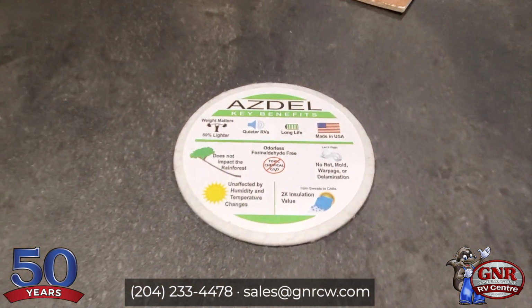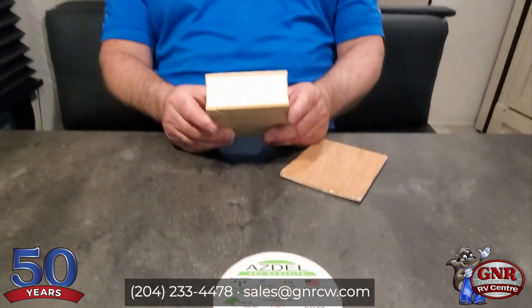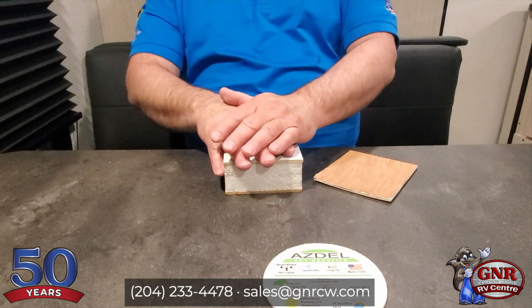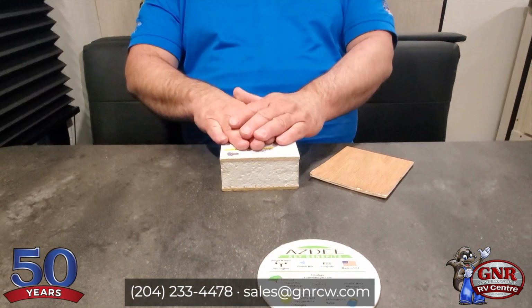So, with the wood backer, this is still the way most cheap brands are doing it. And it's unfortunate, but hopefully eventually they all switch. But the other thing too, with Coachman Apex, just for example, the different ways that you can build a fiberglass sidewall, some of them just glue it and walk away. Coachman Apex, they roll it through a roller and it spreads the glue out more, and then they vacuum bond it right on top of that. It gets all the air out and squishes everything together nice and tight. So that's double insurance, almost triple insurance with pinch rolling, Azdel, and vacuum bonding, that the trailer should not delaminate. It's still possible, but again, it's very, very unlikely that that trailer will ever delaminate. So Azdel is the way to go.